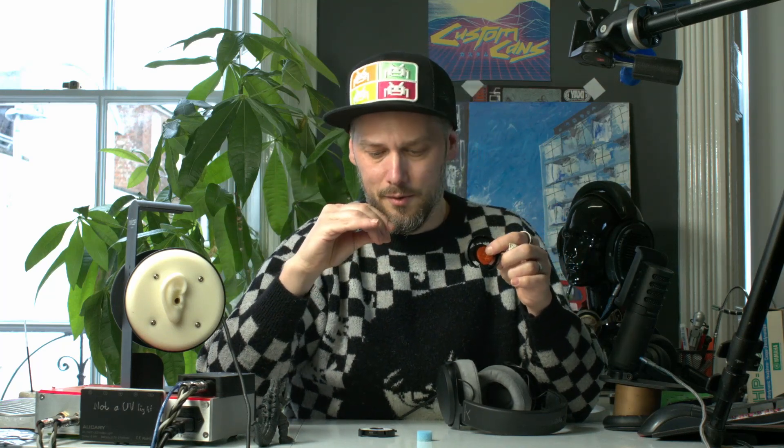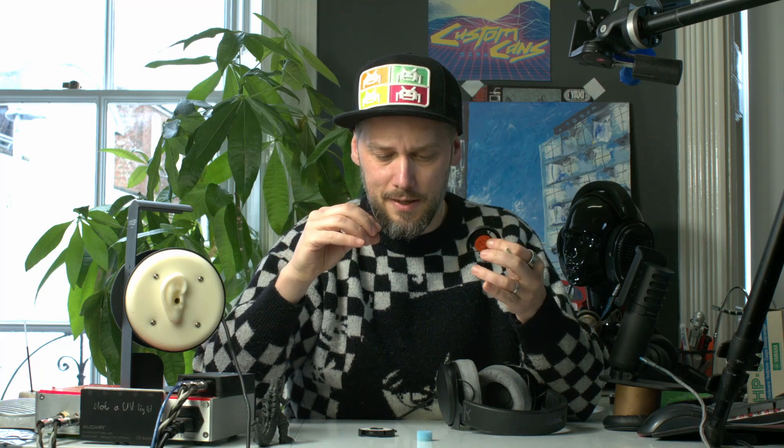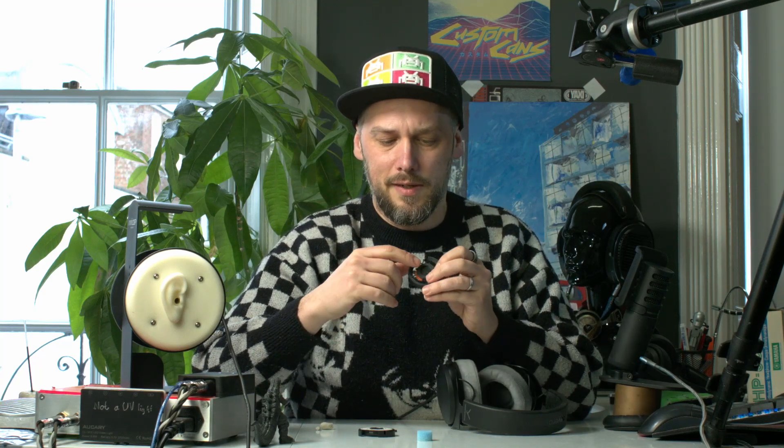This orange doohickey just goes in here so that the piece can't get pressed too close to the magnet - it gives it a little bit of breathing room so it can breathe through the back of the magnet. The dip at 4k where we were getting that phase reversal was due to sound coming out of the back of the magnet. I found that pretty early on with the plasticine - if I blocked that hole on the back, suddenly that dip started to disappear. So it's basically sound coming out the back of the magnet interfering with other stuff bouncing off, giving you weird cancellation. Putting a cover over the magnet but still letting it breathe a little bit was the main fix, and then I smoothed off a few bits for airflow. All of these things work together - when I covered the back of the magnet it caused other problems that needed fixing too.